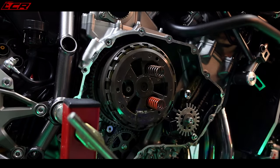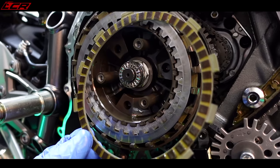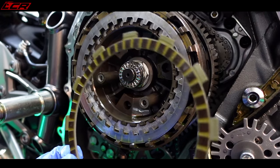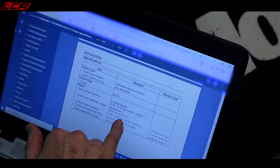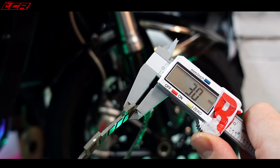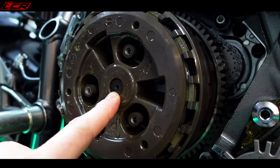Plate off. These are the standard orange springs. The main cover should come off. They're not black, they're not scored. The manual says friction plate thickness between 2.92 and 3.08 millimetres. My clutch plate slots in nicely at about 3mm. Looks like they're fine. I'm going to put them back together. I think I'm going to leave the clutch plates alone — doesn't seem to be much wrong. There's almost hardly any wear on the clutch plates at all. It all looks good. Quite pleased about that.